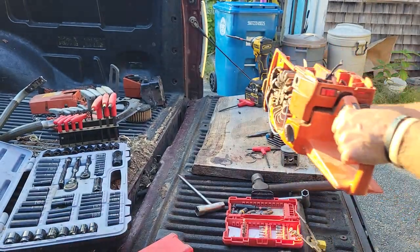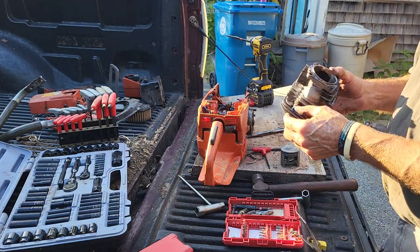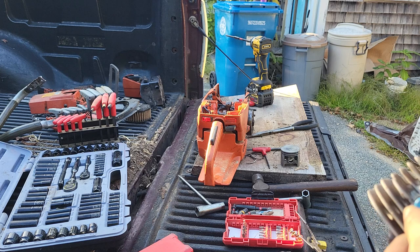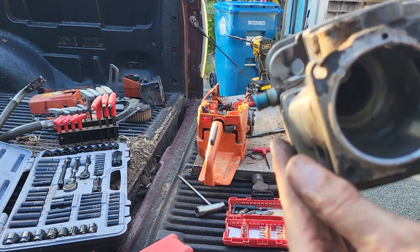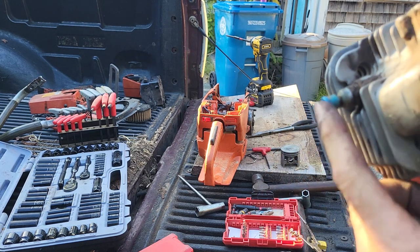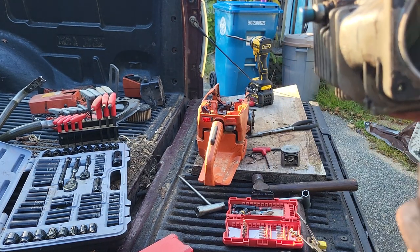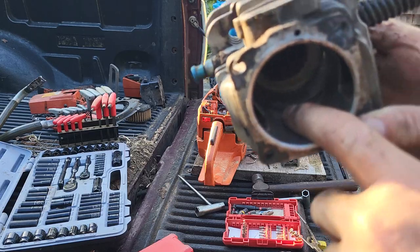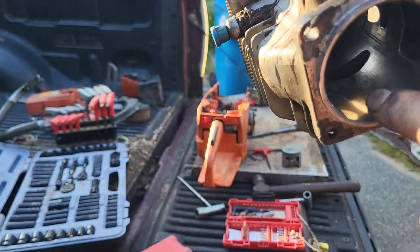It almost looks like, I wonder, is that the side where the, it is. This is the side, here, you know, here's a possibility, guys. You see where that decompression valve is? I'll almost guarantee it right now. It's on the decompression valve side. See that there? I bet. I almost guarantee it. This decompression valve stuck open. He ran it and got the white hot jet from hell right from there, right to there. Hold on. Sorry, I didn't have you on camera. See where the decompression valve is? That's the side that cooked right here.